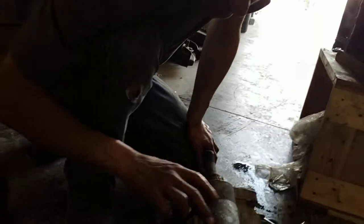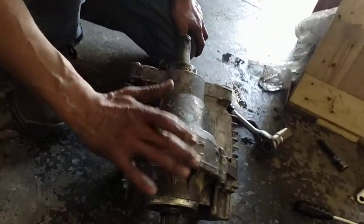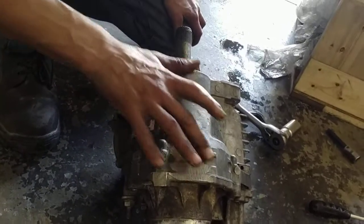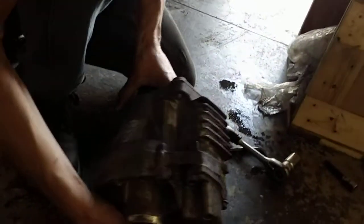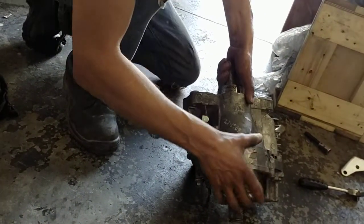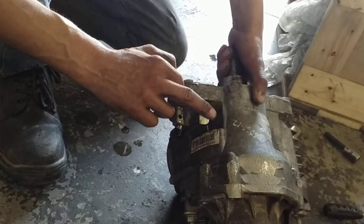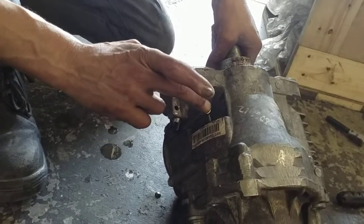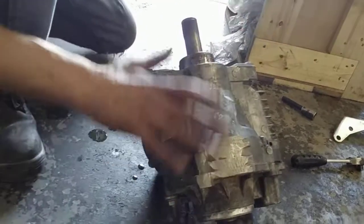What will also help is on the transfer case — on two points I removed a little bit of material. Over here there were some casting blobs which I just ground off, probably about two or three millimeters removed there. That also helps you not to take too much off the block. Then there was another spot — this little blob over here, also a casting blob — it actually stands quite high. I removed all of that completely down to the web. That also helps you not to take too much off the block.